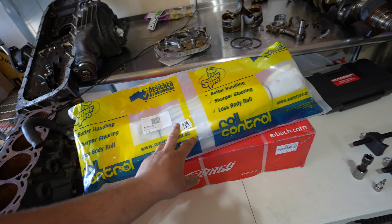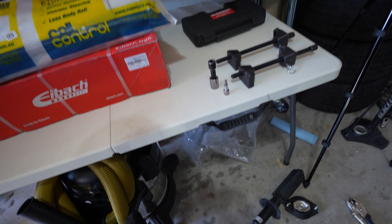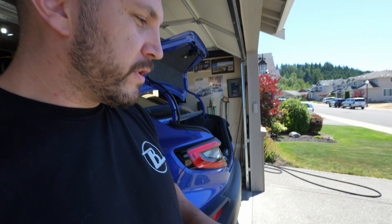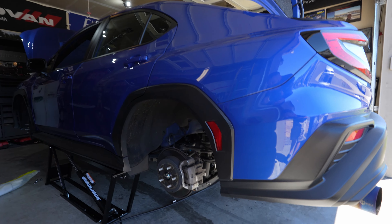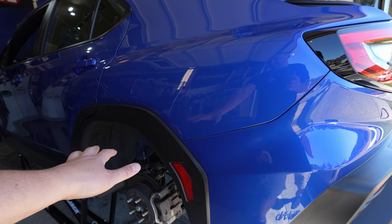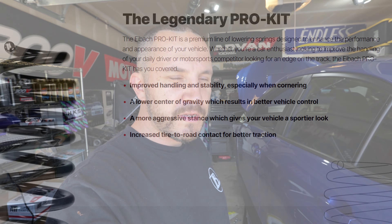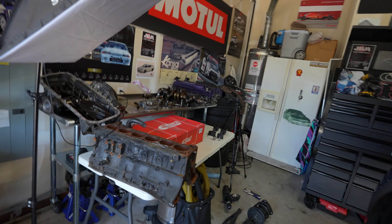We also have a set of Super Pro rear adjustable lower control arms, and that's going to replace the stock ones which will keep our suspension geometry in perfect alignment — we're not going to get a bunch of toe wear and premature tire wear. If you're looking for a cost-effective solution without coilovers, the Eibach pro kit is going to get the car about an inch lower in the front and rear. These are progressive springs, so it should take out the bounciness you get with the stock suspension, especially on the freeway.